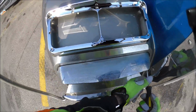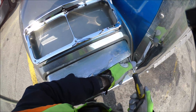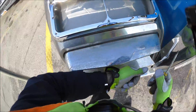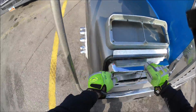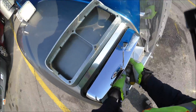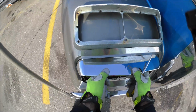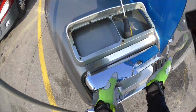And the plastic here, instead of the chrome, you have to polish it. The aluminum, of course, is always a heartache. But the Peterbilts have a harder aluminum, so you really have to cut it harder. With their headlights, you have to polish it all. And here, on the Freightliners, you just replace these. With the Peterbilts, they have aluminum that you have to polish. They're not actually metal. Even this crown here is not stainless. It's actually aluminum you have to polish. So there's so much love that you can put in those old dogs.